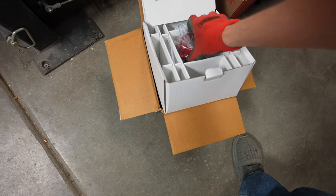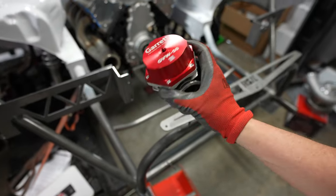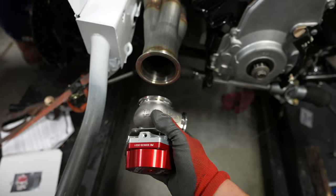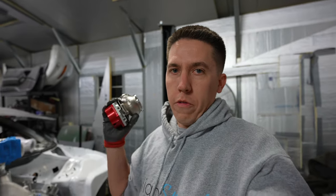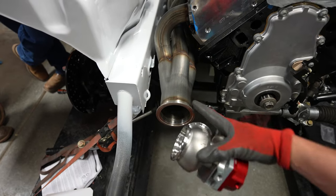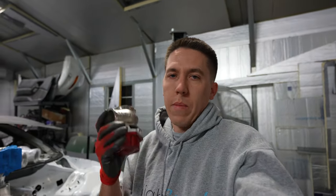If you haven't subscribed yet, do that right now. The last pieces I got from Garrett were two of these 50-millimeter wastegates — super nice, super clean, give a little color to the engine bay. Thinking about where to put them: it's going to be super tight to fit everything, but if the turbo turn goes over the turbo right there, the wastegate might just line up perfectly. I'm a huge freak about making sure your wastegate is well-positioned on the exhaust side because you do not want boost creep. Ninety percent of people that end up with boost creep just don't put their wastegate in the right spot. You actually want the exhaust to flow into the wastegate better than it flows into the turbo so it becomes the path of least resistance.